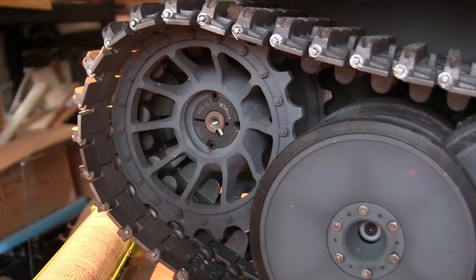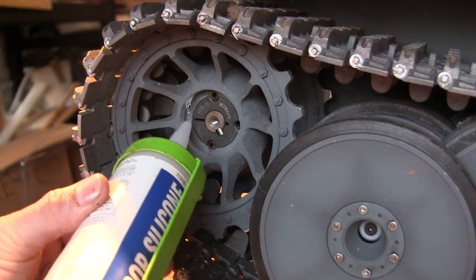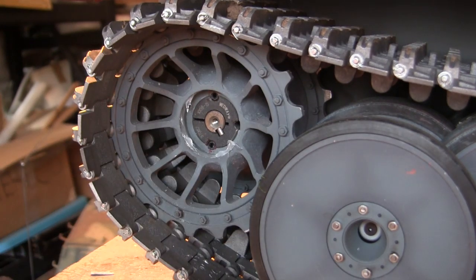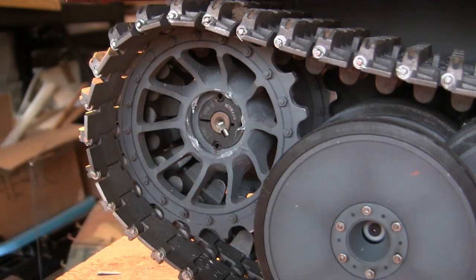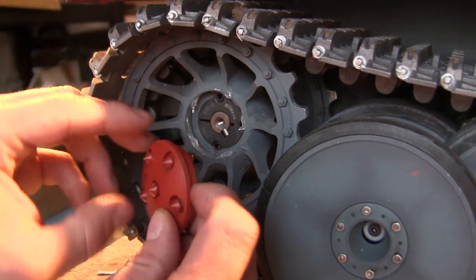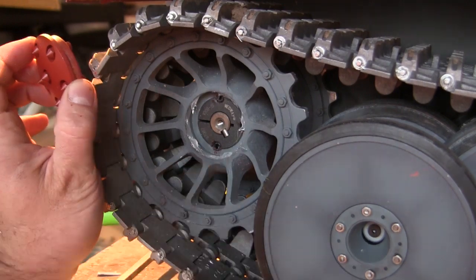The hubcap has a coat of primer and for installation I'm going to use silicone, the same system used on other Armortech builds on the ECA channel. The silicone provides a nice strong durable bond, and it's also temporary — if I ever need to get access to the spindle I can just pry the piece off without causing any damage. The piece stays on securely so you don't have to worry about it popping off during operation. I'm using just a small bead applied to the inside portion of the sprocket, not the rim — adding it to the rim would cause silicone to gush out on the corner and leave a seam to wipe away. Doing it this way, the silicone expands on the inside, reducing any smear on the outside.